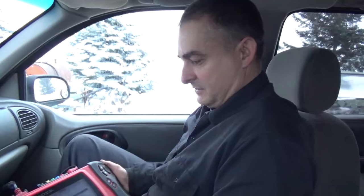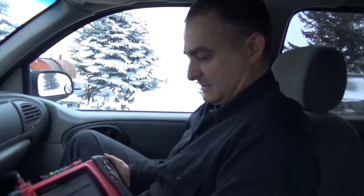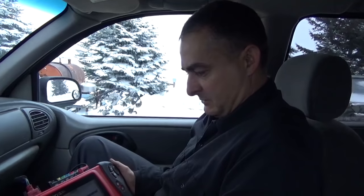Okay, we've driven about 15 miles in the vehicle. We've gone through all the history codes, the failed ignition codes, any requests for maintenance indicator light, last test failed and test failed since code cleared. Everything's clear, everything's good. So we're going to return this to the customer, and I believe we've put this problem to rest. I think we just had a bad cam phaser solenoid, and I think a lot of it had to do with the fact that the debris in the screens were stopping the flow to it. And also the varnish was probably keeping it from moving like it should.